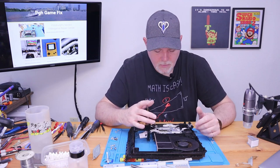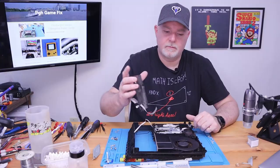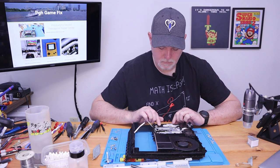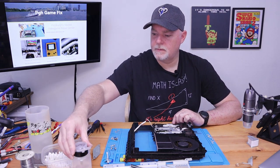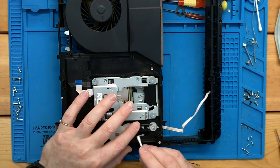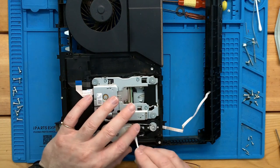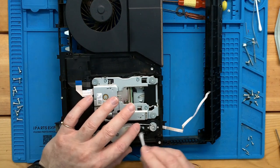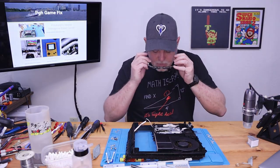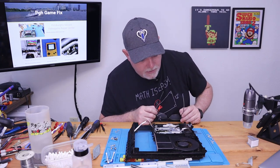like that. We don't have too much dust in there. We'll take our laser ribbon off also. Okay, this belt is sometimes the culprit if things aren't running right. On a lot of the earlier Xboxes and whatnot, I'm starting to change them because they're fraying and they're showing signs of distress. But usually on these newer systems, you just got to clean them with a little alcohol.